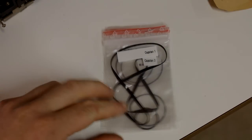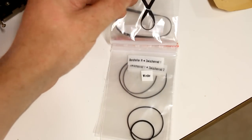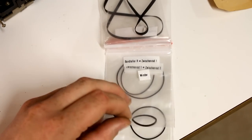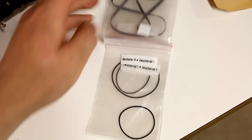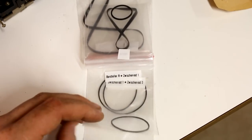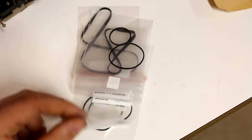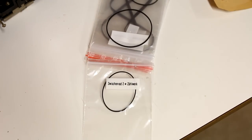My analysis here was that after almost four decades, the old rubber belts are simply worn out. I ordered a replacement kit for this exact model on the German eBay website — I put a link to that in the video description. I paid 20 euros for this kit, but since this is actually a valuable collector's item, I think it's worth it.